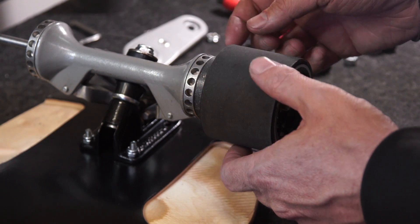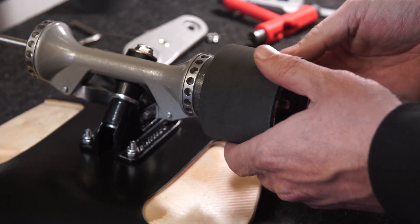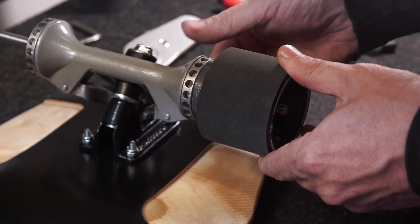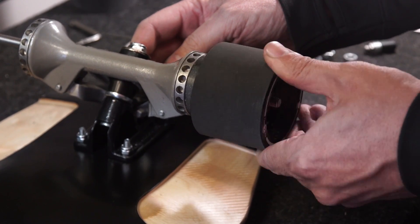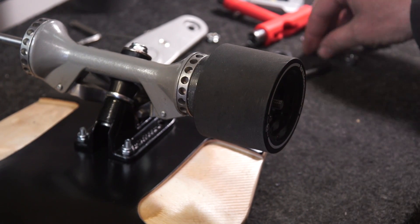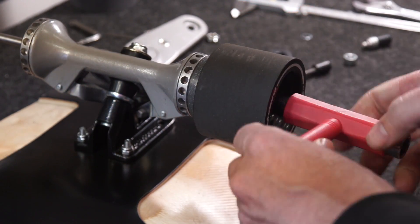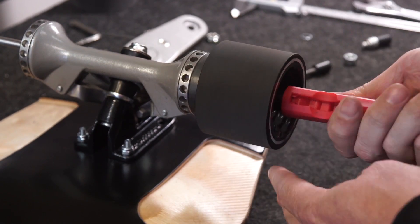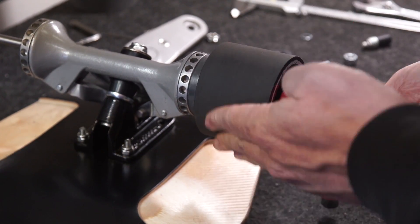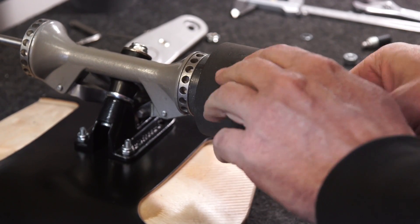Check now to see if your lining is sitting straight. The gap between the two needs to be one millimeter or less — you can do it by eye, doing little quarter turns until it's as close as possible but still free spinning. Make sure the wheel is all the way in and that gap is still there. Put the outside racer washer and the outer axle nut. Tighten the nut until the wheel starts to slow down — a bit of load on the bearings — then back off a quarter turn. Spinning the wheel while you do it is a good way to see if you're too tight.